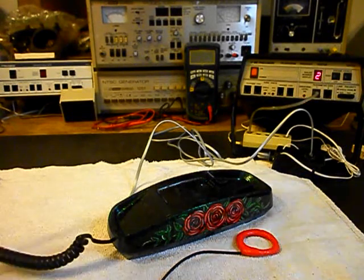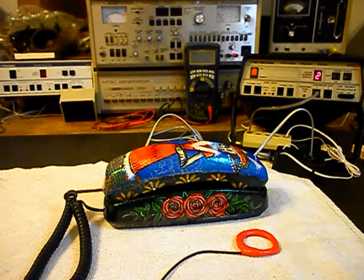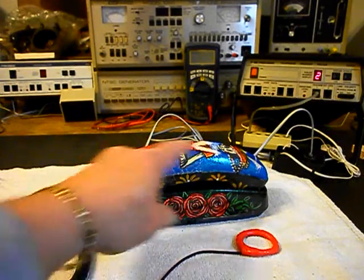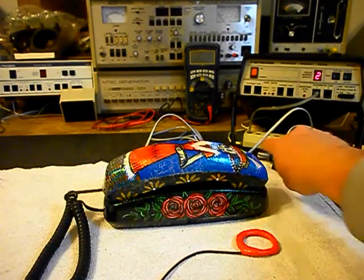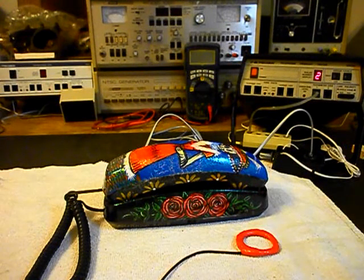Hello, hello. Now that we know this telephone is dialing out, it's ringing in on a ring cycle, and it has transmit and receive, we can push this button on the switch box. That gives us a line out and totally takes the analyzer out of the situation, and we can call a time and temp number.